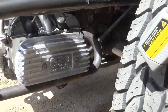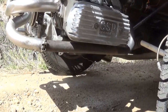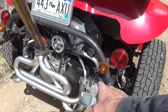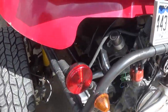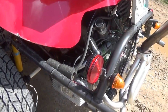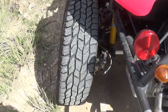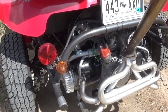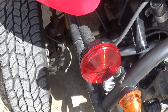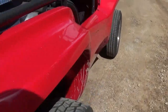I don't see any marks on the exhaust pipes where they've been weeping. Well, they do it as advertised. I did have to put the cork gasket on it. I pinched that O-ring on this side, darn it, and didn't hurt it though. And I ended up leaving the O-ring on there and putting the cork on it dry, and that's what it is, and it's not leaking. So there you have it. And with those fins and stuff, and being aluminum, it should help dissipate the heat. Got my MP emergency brakes with, you know, the emergency feature. Boy, I'm just tickled. Tickled, tickled, tickled.